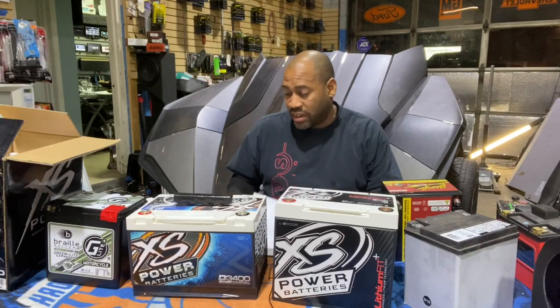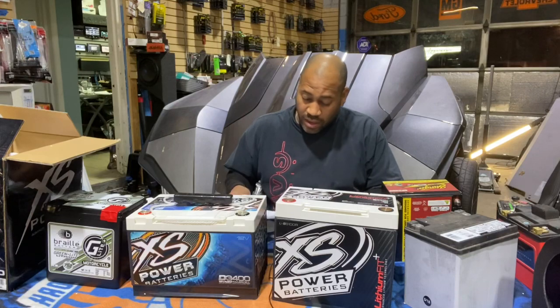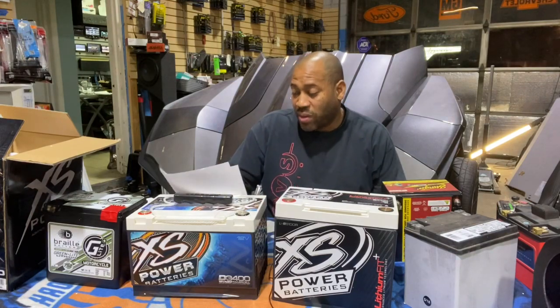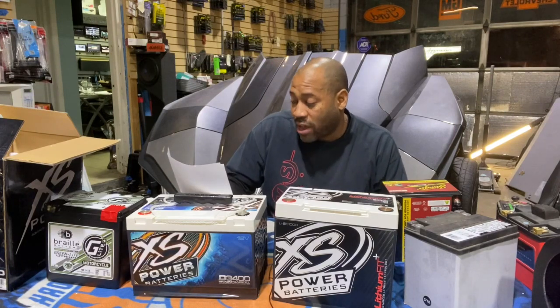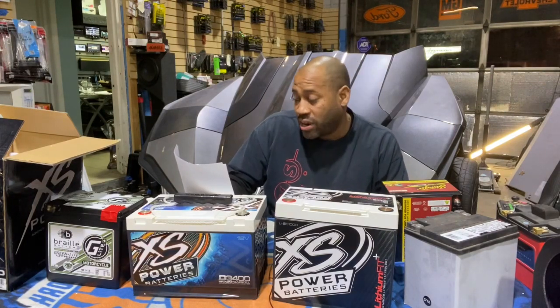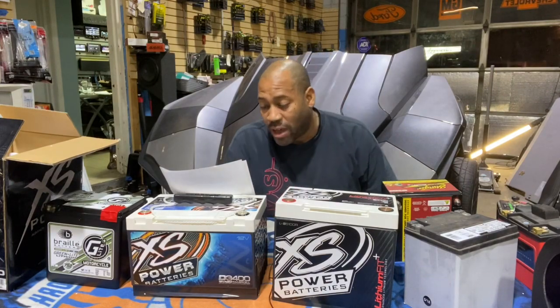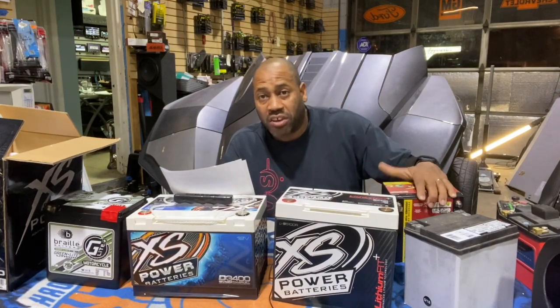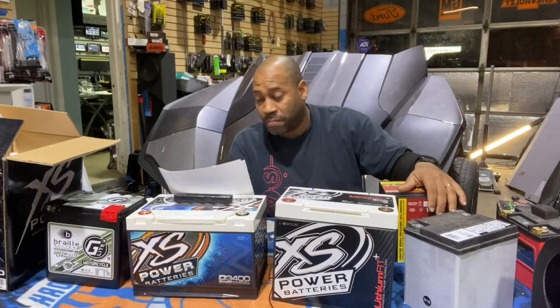So in closing, I've made a list and tested all the batteries. You basically get what you pay for. If you're between 23 amp hours and 40 amp hours, you're going to pay between $700 and $800. I listed them in order of amp hours and price. The Stinger AGM comes in at $300. It's the least expensive because it's not lithium. This is good for 1,500 watts, NVS Audio certified, a drop-in fit, under-seat replacement for every Harley.